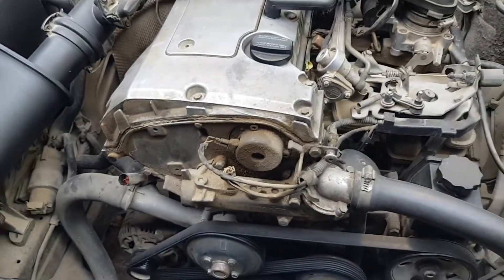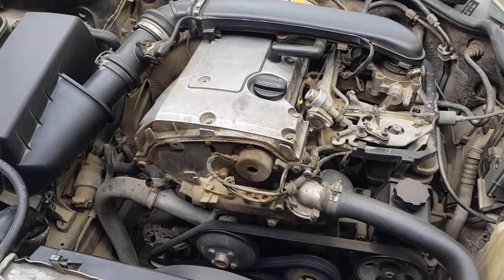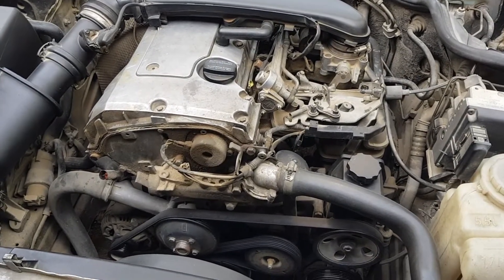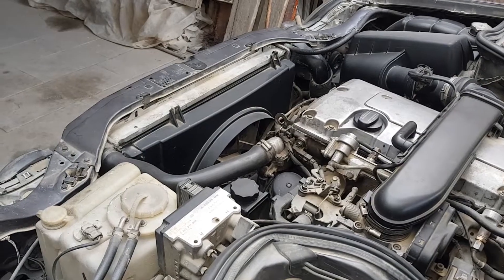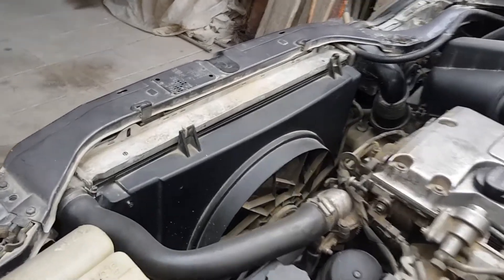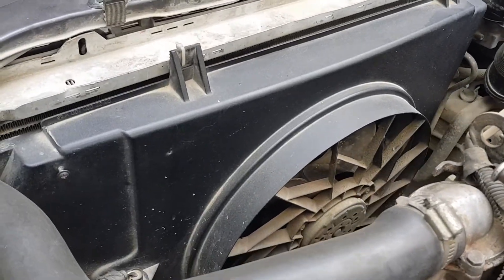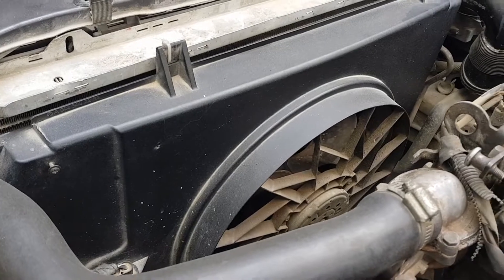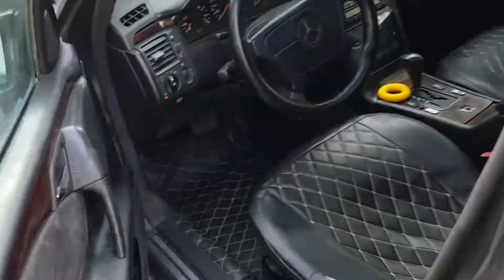The reason was as follows: there is a temperature sensor on the pump which is connected to the liquid cooling fan. When the fluid temperature rises, it sends the information to the engine ECU. After that, the fan turns on. In your case, this temperature sensor is the one that needs to be replaced.